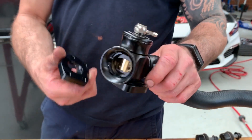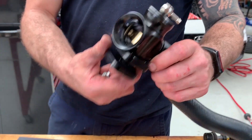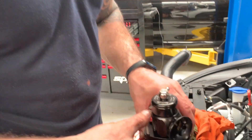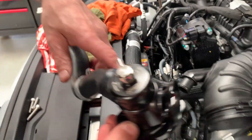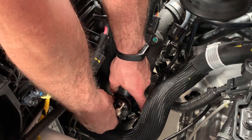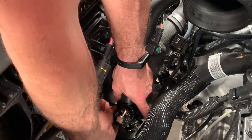So I've changed over the plumb-back hose. Like I said, it's got an adapter plate and I'll be fitting it back to the intake now. The blow-off valve on these is very easy to get to — it's just a matter of removing the air box. The blow-off valve is on the cold pipe. Simply fit the adapter and the new blow-off valve and you'll be ready to go.